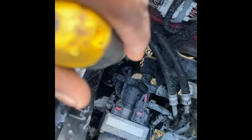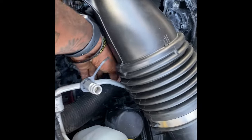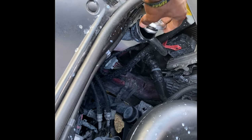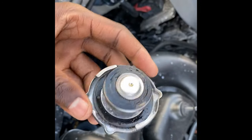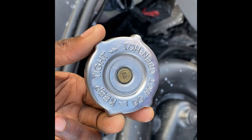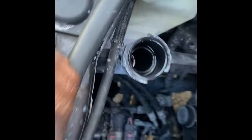They have a drain area on that side as well but it'll go this way. Just twist once to make sure nothing's coming out, push down and turn to your left, pull up — and you're good to go. Always inspect the coolant cap to make sure there's no cracking or damaged seals. If your seals are messed up you should definitely replace your cap. I replaced this cap about six months ago — it's a Mopar brand from the dealership. As you can see there's coolant in here, so we have to drain it from the petcock.